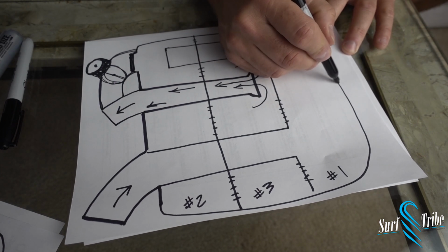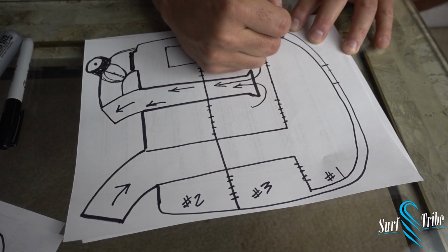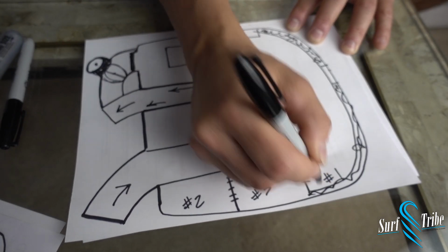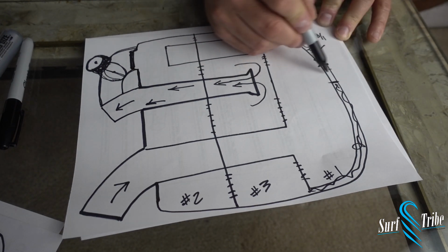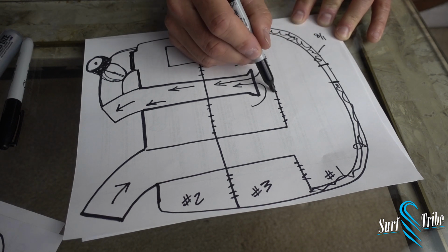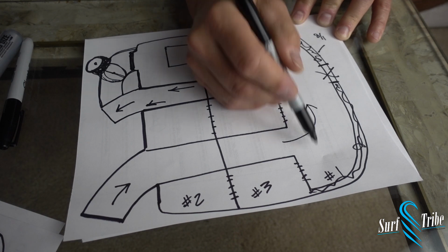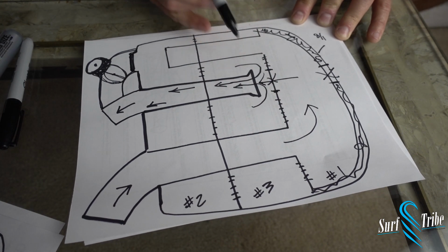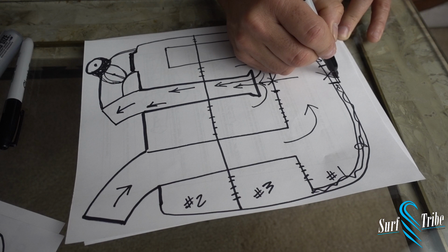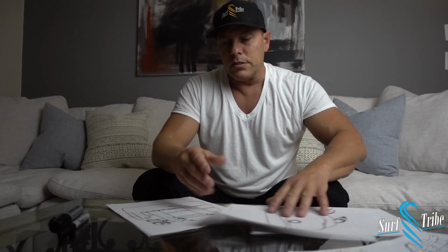So I just drilled the hole through here, straight through, and then this wall in here, there's actually 2 walls. They're both pretty thin, but inside here there's packing material, like a fiberglass packing material to help silence the mufflers. Drill through the 2 holes, and then once you break through, you will see the chamber wall in here, and again it's about as thick as this, and it's just one, and I just drilled straight through here. So all that's gone, and that's gone. So the exhaust can come in, fill up this chamber, and then flow straight out. And then I just got a stainless steel plug and put it in here like this. And that was it.